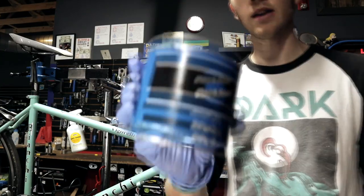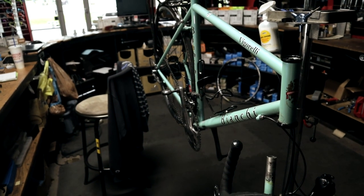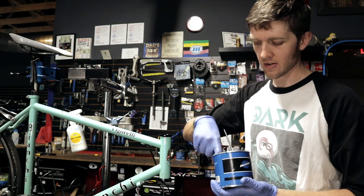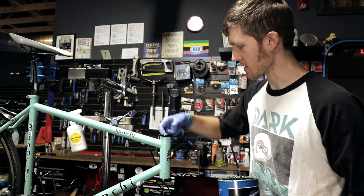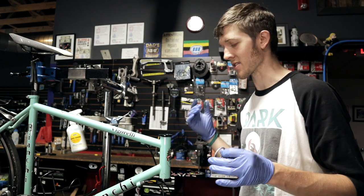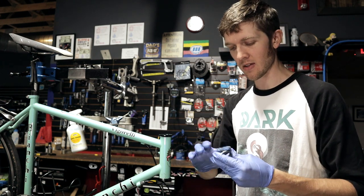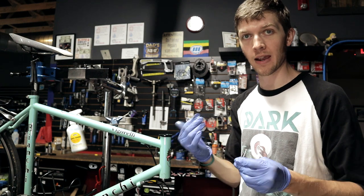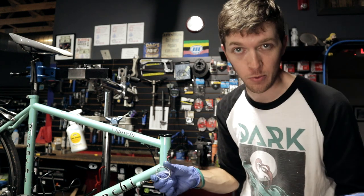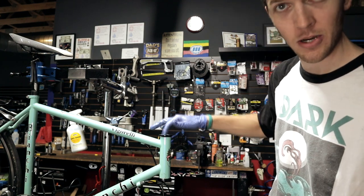What you want to do now is get yourself a big canister of polylube. We have something you can kind of swivel around in there, but whenever you're doing a complete headset overhaul it's just easier to use your finger — dip your finger in it and start going to town. To ensure there is no grit, grime, or parts that can make noise on a headset, I grease each part individually, even if it's just a light coating, before I put it back on the bike. Your bearings can only go in one way, and you're going to know if you put it back together wrong because it's gonna feel like crap. Got the inside of the bearing greased.